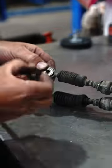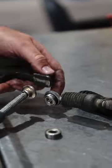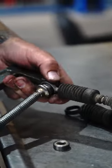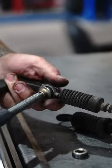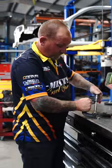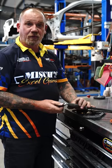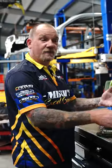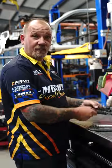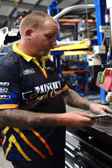Now these bearings, we supply them — they are a direct perfect fit for these. Get the G-clamp. Sometimes getting it square is a bit tricky, so we'll give it a couple of goes. There we go — back it off. Voilà, beautiful. We've now solved any extra slop that you may get in your gear shifter. The ease of not taking these cables out of the car and doing these while they're in the car — simple G-clamp and screwdriver, two very simple tools to do it.